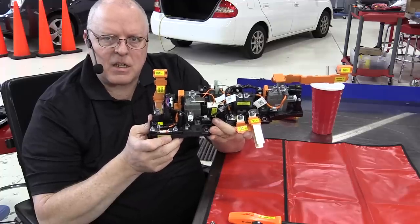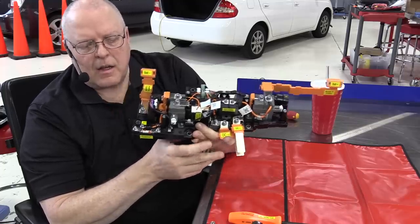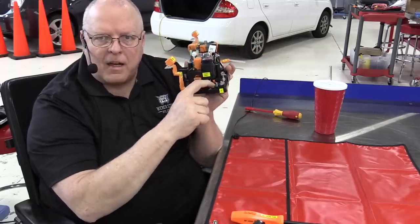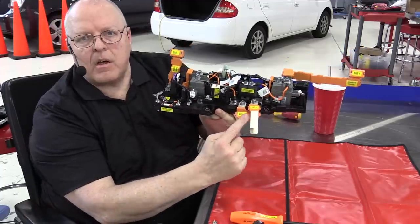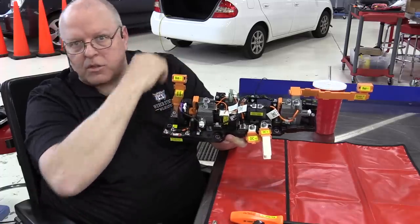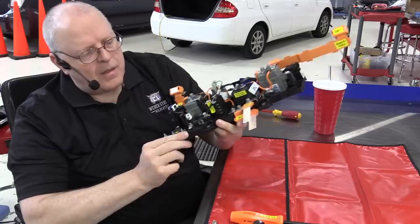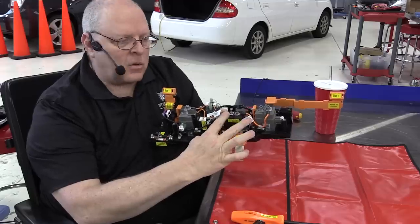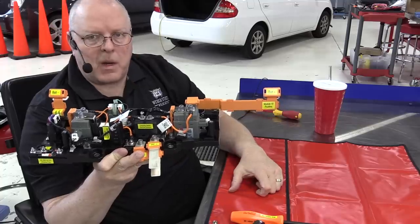Those chargers send AC current to a special box underneath the hood called the charger module or something like that. It then has a special connector at the front of the battery that has a positive and a negative terminal that connect right here. The negative terminal right here just has a wire that comes over to this negative terminal from the battery that connects then through the negative contactor and establishes a connection to the battery modules. The positive terminal here through this fuse then has a wire that comes over to our charger contactor that, when it closes, bypasses the positive contactor through this wire and charges the battery, but at a lower rate of current.